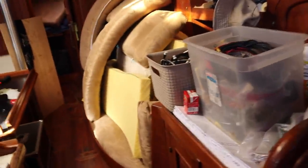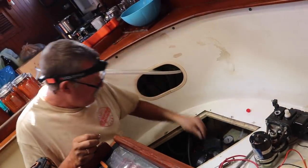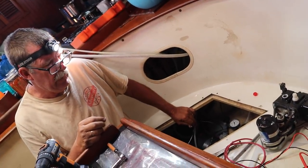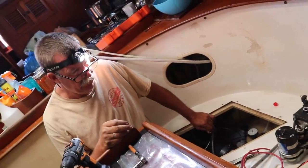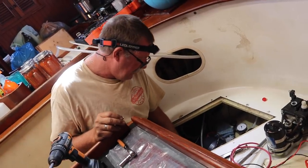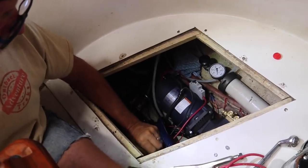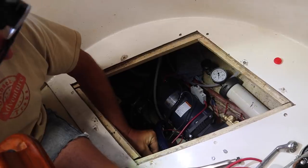Right, do you want to try that? Yep. What was the problem? Because we just tried it and, what didn't work? The solenoid? Yeah, there are two types of solenoids. There's one type where the coil needs a positive and a negative wire. And there's another one where you only need a positive wire, but the negative needs to go to the casing of the solenoid. So this was the second type. Excuse the mess down there, I haven't finished yet. I'm just making sure everything's going to work before I tidy it all up and bolt it all down.